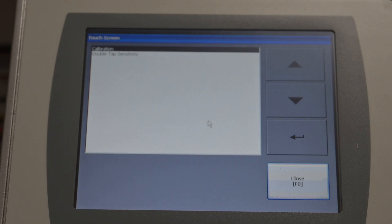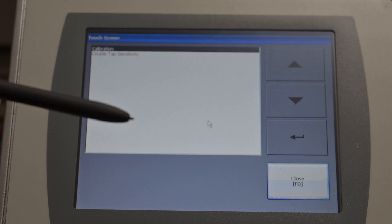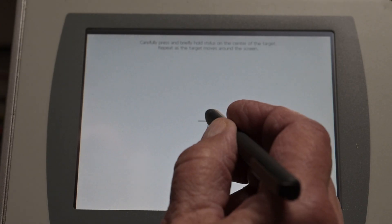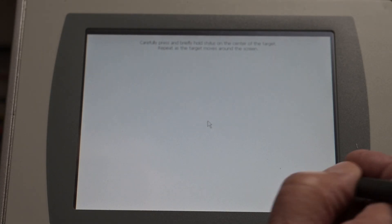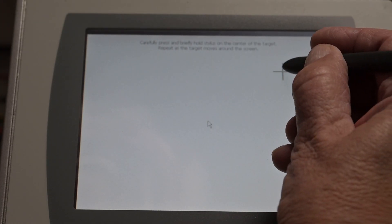As I showed in the other video, I've got a stylus from a Samsung tablet — it has a really nice little nib on it. This is something that, if you've got it available, use it. You can use your finger but you won't be quite as accurate. Don't use anything really sharp. So we're going into the calibration screen — hit Enter and there are going to be nine presses. First one right in the center. You want to be as accurate as you can. And we're done.